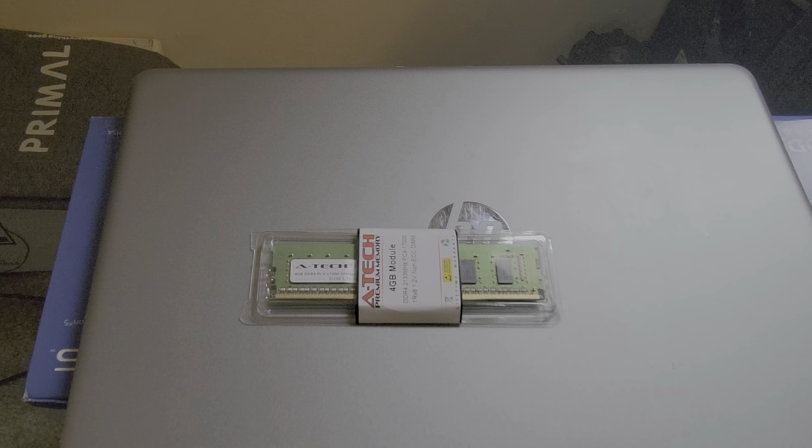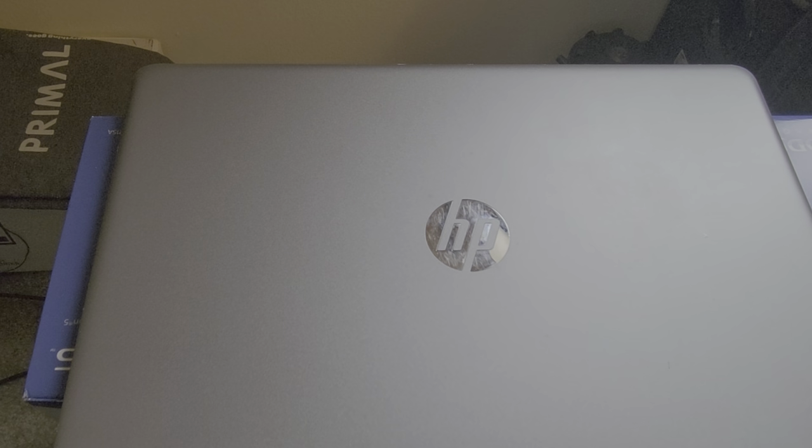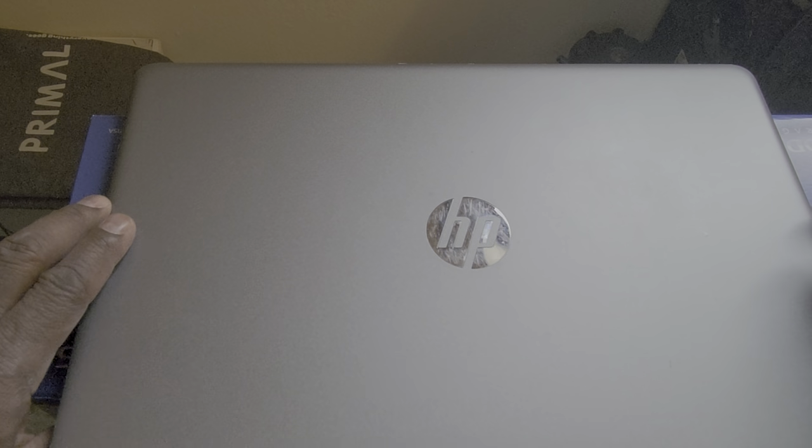If you're into doing video editing, photos, Photoshop, you may need more RAM space for those type of programs to work properly. In the case of this HP, definitely need a RAM upgrade. So I'm going to add 4 more gigabytes to the 12 that already exist to see if we can make this thing run faster. First thing we want to do, we want to flip the computer over on the backside,